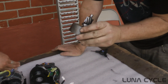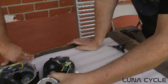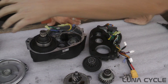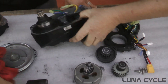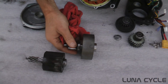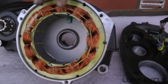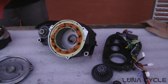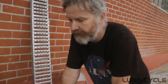Motor design-wise — and we'll get a motor expert to talk more on this later — you can see how the stator is flatter; they call that a pancake motor. This one is much thicker. What it gives you is a larger diameter, which is also good for gear reduction. The larger the circumference of the motor, the more efficient it's going to be. Our guess is it'll take a hell of a lot of power.